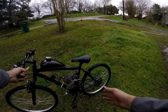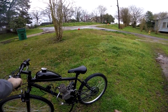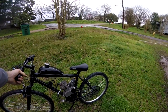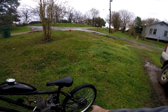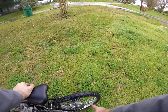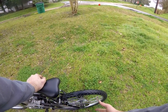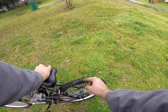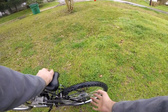Because the motor was broken in a long time ago, I went ahead and started pushing this bike full throttle right from the get-go — some bumps, hill climbs, lots of torque, as much as I could give it. This was so that if there were going to be any issues on the bike, we would find them now. But more importantly, we were able to set the spokes and the rag joints. After your first ride, as I mentioned in previous videos, you need to go back and check all the nuts on the rag joint. As they settle, the rubber shrinks and moves into different positions — these nuts can lose tension. We also want to go ahead and check the wheel and make sure it's still trued. The spokes don't always set right away, and as you ride with the weight, speed, and vibrations, the spokes will set into their final position, allowing you to get the final adjustment on the wheel for true.